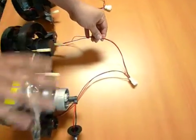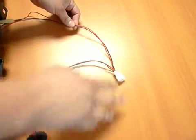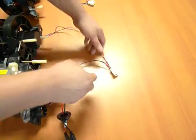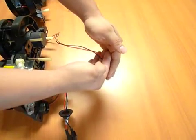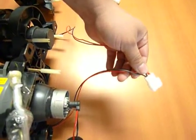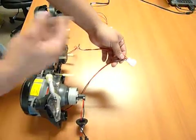Now if that's the case, we're going to want to look at this connection right here, because on your vehicle this connection will tap to somewhere. There will be a connection that your installer made, where this is connected to some other wires, and this may even be cut off on your setup depending upon how your installer set it up, but these wires will be connected to some other wires to draw power. If these wires do not get power, these angel eye rings will not light up, and so that's essentially the issue right here.